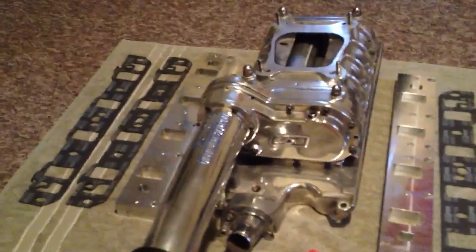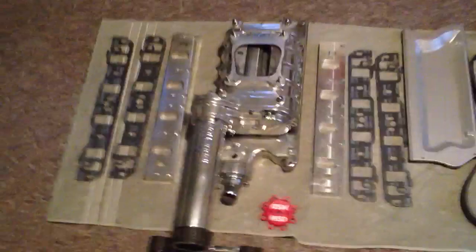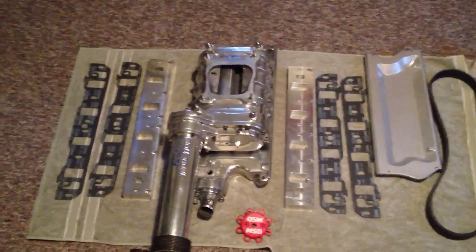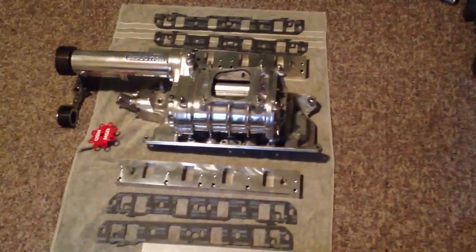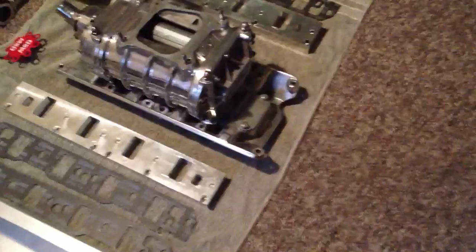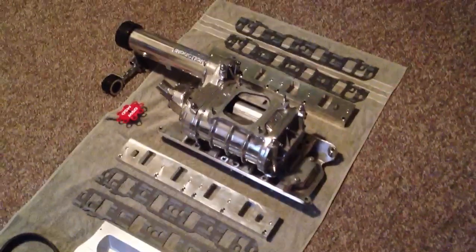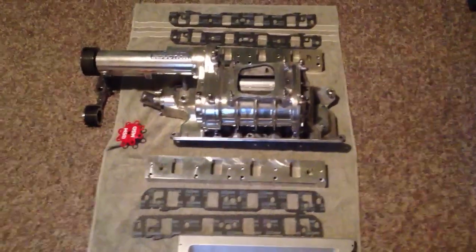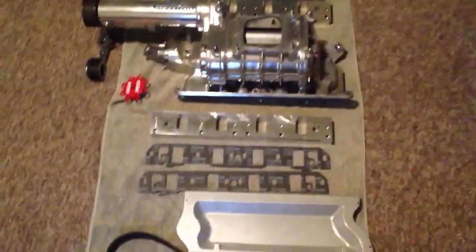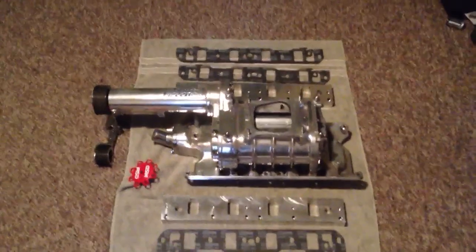I'm using it for this blower application, but really, the good thing about this is that people really didn't make any unique intake manifolds for the 351 Windsor. You can get a medium rise 351 manifold or an air gap 351 manifold, but basically just a single four seems like that's all that's offered. The 302 and the 289, on the other hand, have a variety of intake manifolds — triple deuce setups, dual quads, tunnel rams, superchargers. So with this kit, you can put any intake manifold for a 302 on a 351 Windsor.